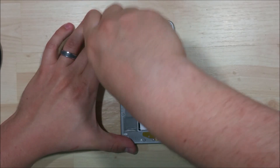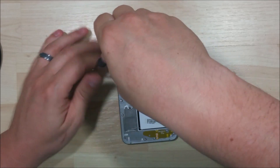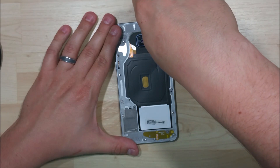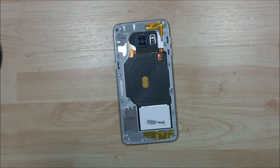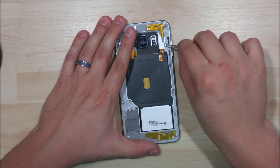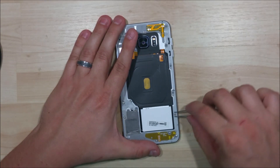One other thing you may want to do before you start to repair your phone is clean the surface you're using. I used some alcohol to clean it off to make sure there's no dust and no pieces of glass or anything else that will scratch your screen. We're making pretty good progress — just a few more screws to get pulled out here. We're going to grab a pair of tweezers to pull these screws out. You don't want to lose any of these. Sometimes when you start to pull the midframe portion of the phone out, these screws can go flying.